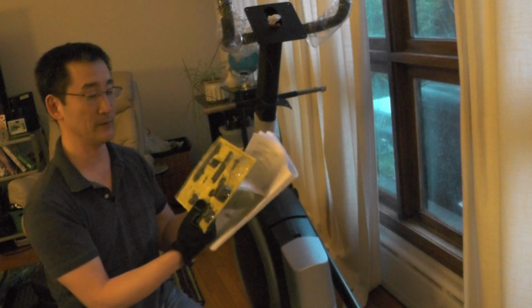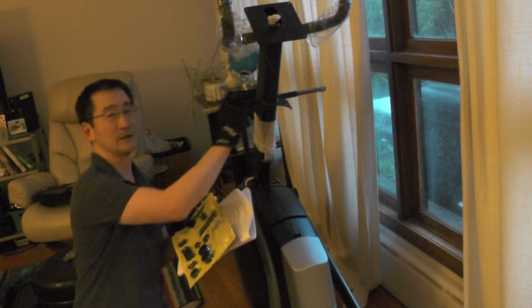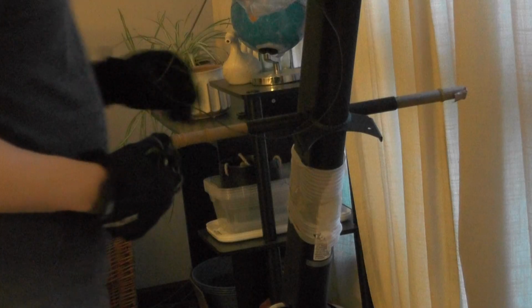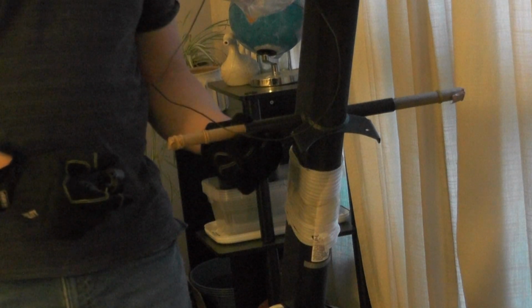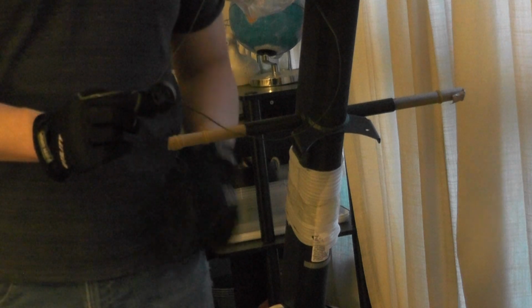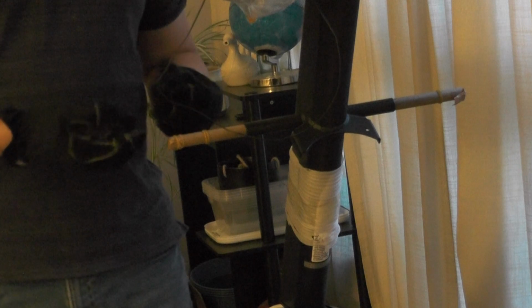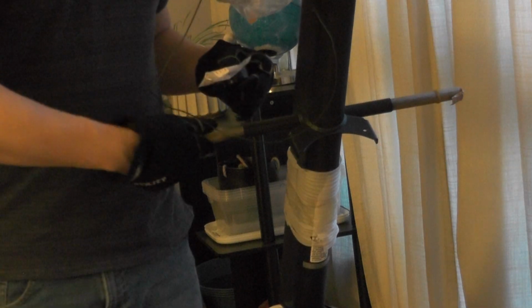Next thing I'm going to do is get a pivot spacer right here. You're going to put this on this number 4, which you're also going to grease. I'm going to add some grease to this axle number 4, and then slide this spacer, which comes in the package, here. I'm going to do the same thing over here. These are symmetrical. They're just spacers. They're already a little greased up, I think.